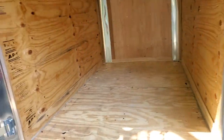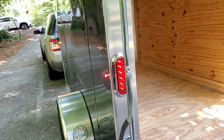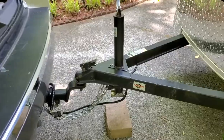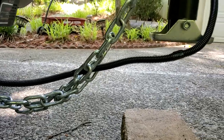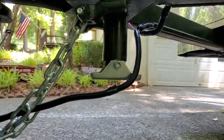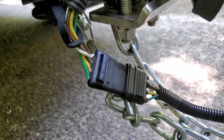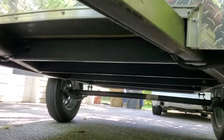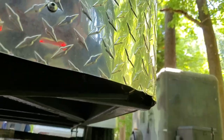If you really can't find anything obvious and you're still having problems, unfortunately you're just going to have to rewire the trailer — and it'll take you maybe half an afternoon to do it. I actually made mine better than it was from the factory. Get some flex loom to protect it, you'll need electrical tape, various connectors, you might need some heat shrink material, and you'll need a heat gun if you want to do this properly. You can actually make your trailer better than before.